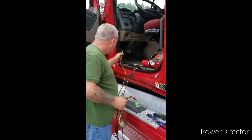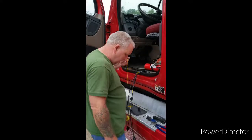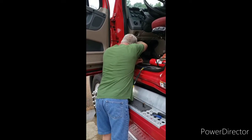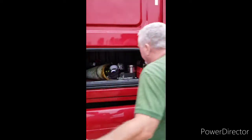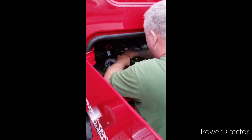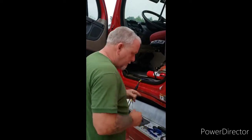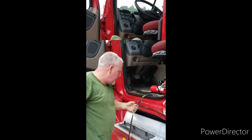So what we're going to do now — this is a power feed wire obviously, which probably is what powers the brain — we're going to do a handy dandy snip job, get rid of that wire. And then just for good measure, come back here and dig through this bag I have right here. We're just going to wrap the end of it with electrical tape just in case — you don't want it accidentally arcing off anything, blowing fuses. Got that wrapped up.